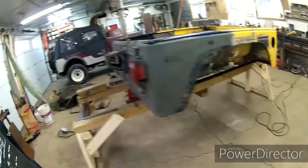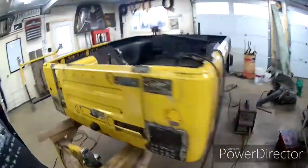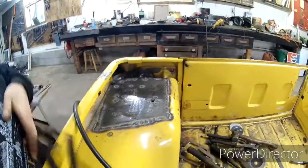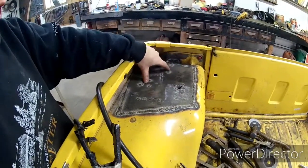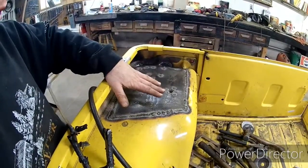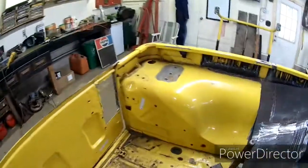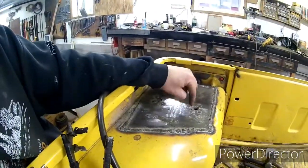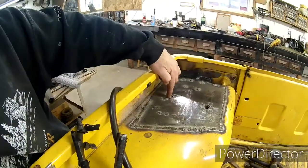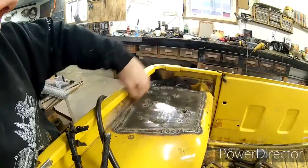And again, this is the back - you can see where the floor is coming into it there. We're going to rebuild and reattach all that. So that's where we had to rebuild this back roll bar mount. There's a piece of sheet metal underneath - you can see these spot welds. There's a cross brace inside the fender well. We had to rebuild the top of that, and these here are tacked to the top of that piece. This is an original section with the original bolt hole - we were able to salvage one of the bolt holes. This is pre-drilled so we can put a hole through here on the back side. This whole piece fills in this section of the fender which was missing.